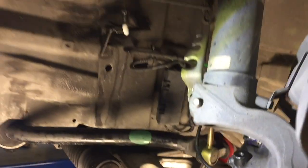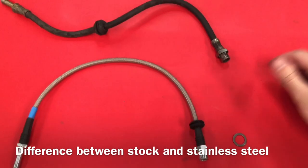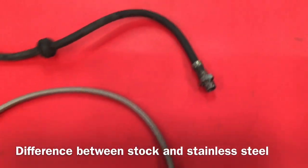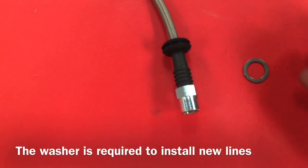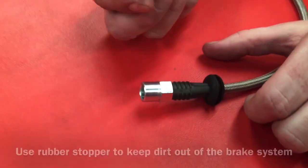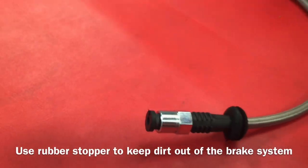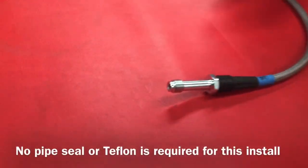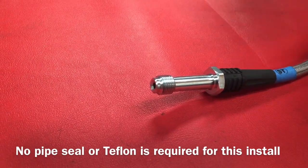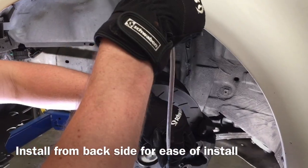The old brake line is out, so now we can install the new line. Notice some differences between your OEM and your new stainless steel brake line. The OEM has some knurling on the edge that inserts into the bracket or connects to the hard line, but the new stainless steel one does not — you'll need the included washer so it doesn't slip through. Before installing, put the black plug in on the side that goes to the hard line to keep it clean while installing. It's important that you do not use Teflon tape or any pipe sealant on any brake parts — the machining does the sealing. Insert it from the back side so you can turn it in straight.